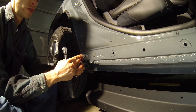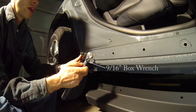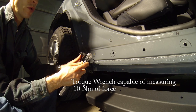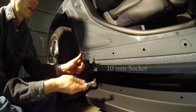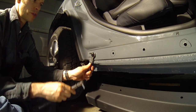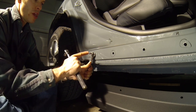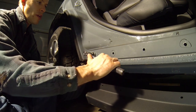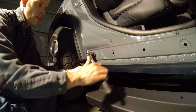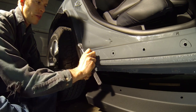In addition to the nut cert installation tool, we're going to need a 9/16 inch open-ended box wrench, as well as a torque wrench capable of accurately measuring 10 newton meters of force, and a 10-millimeter socket to tighten the nut cert installation tool. Use your box wrench to hold it, and it's imperative that you hold it perpendicular to the angle of the sheet metal. Hold it firmly so that it doesn't move, put your box wrench over the top, and continue tightening. It's probably faster to start by hand, but as soon as it's tight, you'll need to use the wrench.